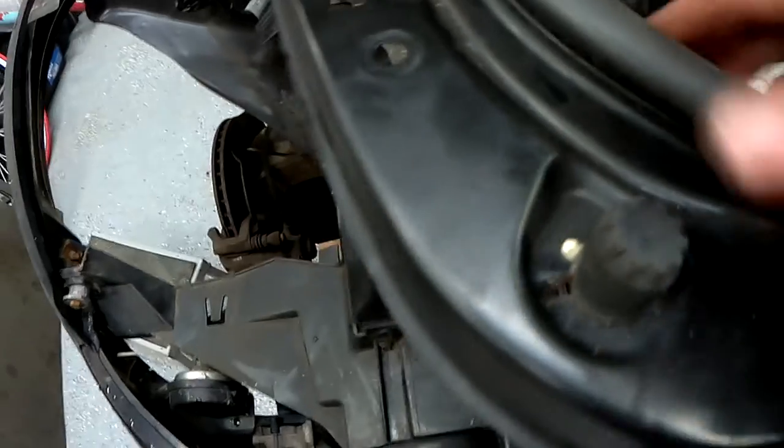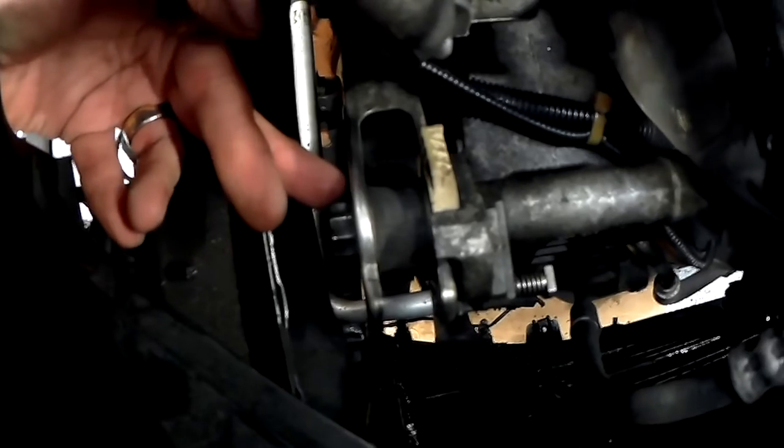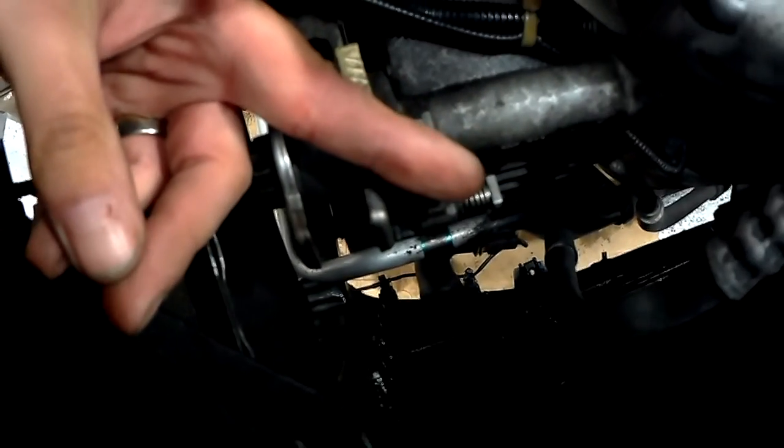Right, if we're going to get a spanner from the top, we need to make a bit of room. So first remove the driver's headlight, or the offside front headlight. It's only 4 10mm bolts, so remove that. There's the spline, so we need to get the spanner on there from the top. So what we have to do is remove the slam panel, which I'll show you next.